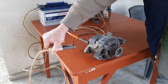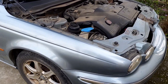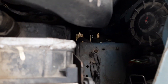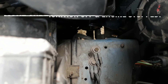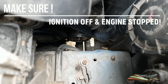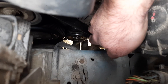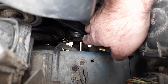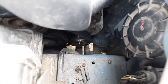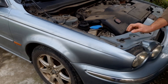As soon as I release the jaw, connection is lost and the range goes down. You can also easily check your alternator's diode pack condition without removing the alternator from the car. Just switch off the ignition and try to attach some 8 or 10 mm wrench to the pulley. The wrench doesn't stick, so the diode pack of my car is working fine. I've even removed the plastic cap of the clutch pulley to make things clear — nothing prevents the wrench from sticking to the rotor, but it doesn't.